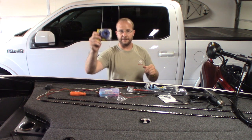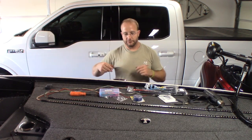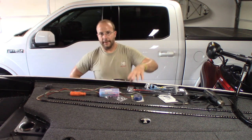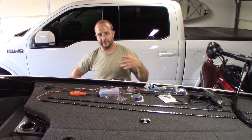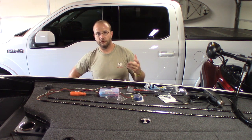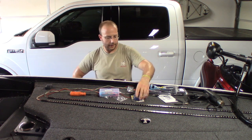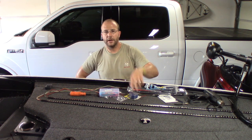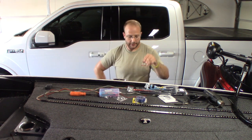The other thing is I got two 20 foot rolls of blue 14 gauge wire. The wire going to my truck is 14 gauge, but I noticed as I went down the trailer to the taillights, it actually drops down to a 16 gauge wire. I'm not overly impressed with that, but I want to stay with the 14 the whole way because I'm running both sides off of one. Only the reverse lights will be ran on that circuit.